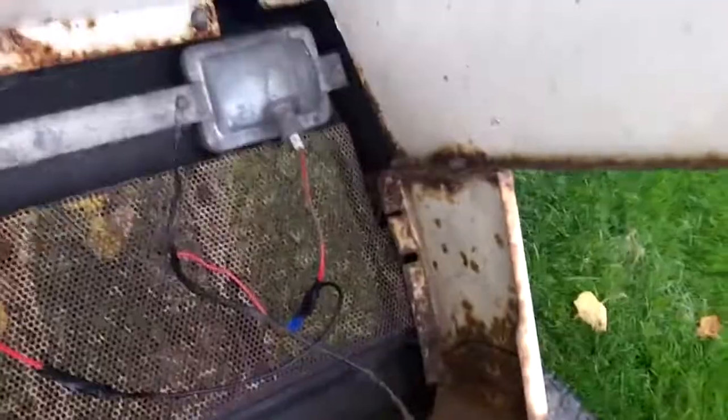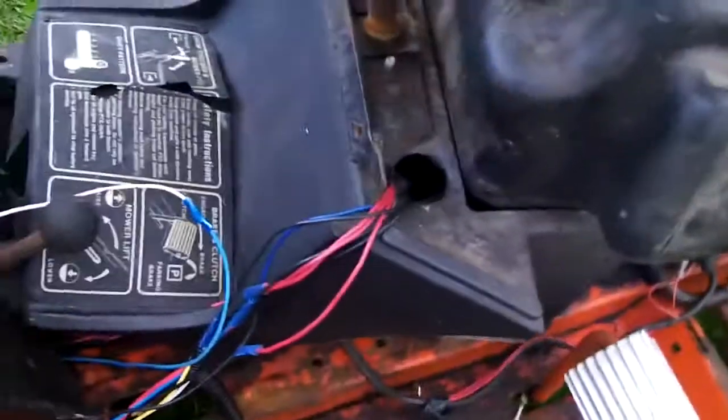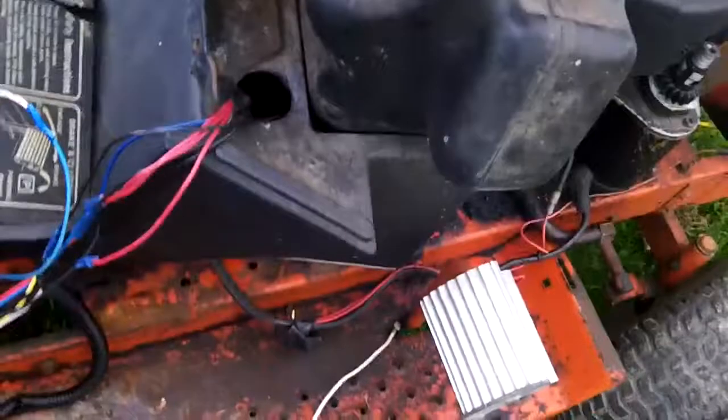My friend rewired it. Now the headlights work. We eliminated those prongs there, put some butt connectors there, and grounded the lights. The lights now work. We rewired it, and now it starts with the key. Sorry, it's kind of a mess. We just haven't finished here. I got it outside. I'm going to garbage bag it because we're going to get a storm.